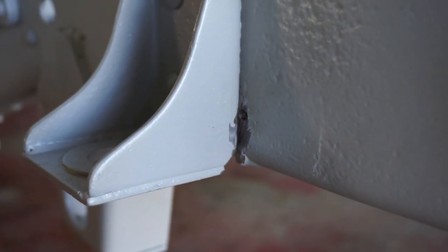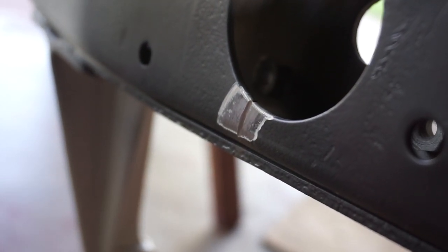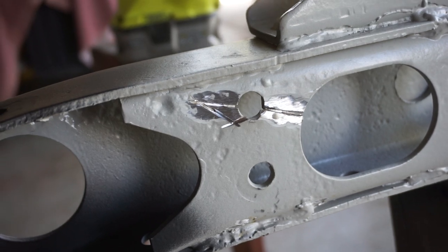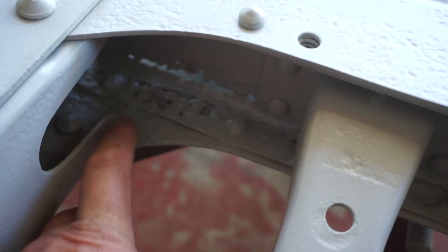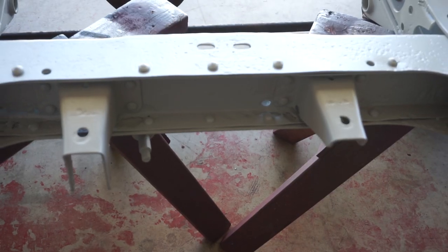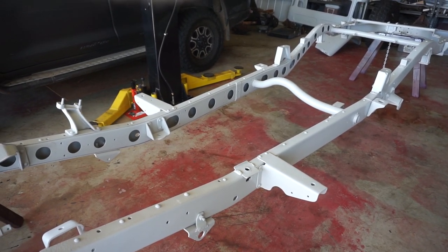I've got three cracks to weld up. That's our first one — I've already drilled a hole terminating the crack so that just needs to be welded now. This is our second crack; it doesn't actually go around the corner, it just sits on the flap. And this is our third crack, up at the very front horn of the frame. In terms of rust, this front cross member has got some cancer in here — there's cancer here and in this corner. So I'm going to replace that entire cross member. McKinnon's Cruisers sell them, so I'll just take that complete unit out and replace it altogether. That's the extent of the cancer and the cracks in the chassis.